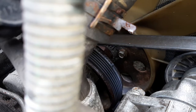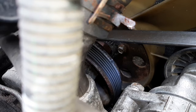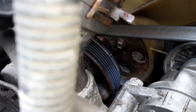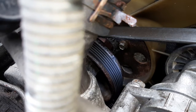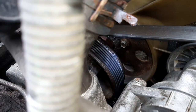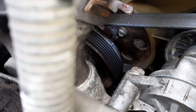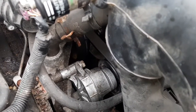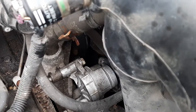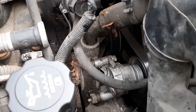I sprayed the silicone lube on the water pump pulley and right away the noise went away. That pulley was single-handedly causing the problem. I made sure not to spray silicone lube on the belt — although the silicone lube is actually safe for the belt and makes it softer so it doesn't harden. After restarting the vehicle, the noise is completely gone, just from treating that pulley.